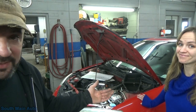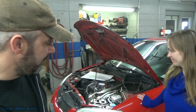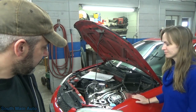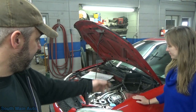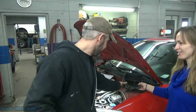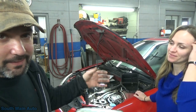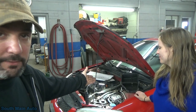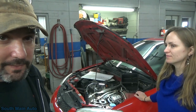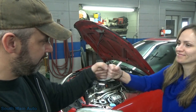I've got the very lovely Mrs. O to bar the engine over for us. We're gonna have to pull the valve cover off this thing probably anyways, but I figured she could come out and crank it over. If we can tell it's coming up on a compression stroke where the valves are closed, we'll do a little leak-down. We'll be able to listen at the oil cap, see if it's coming out the crankcase, out the throttle body, the tailpipe, and then out the other spark plug hole.